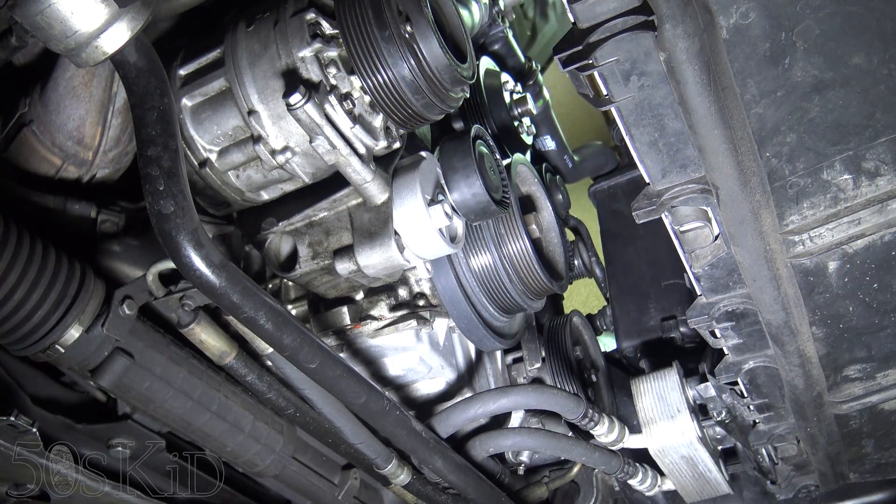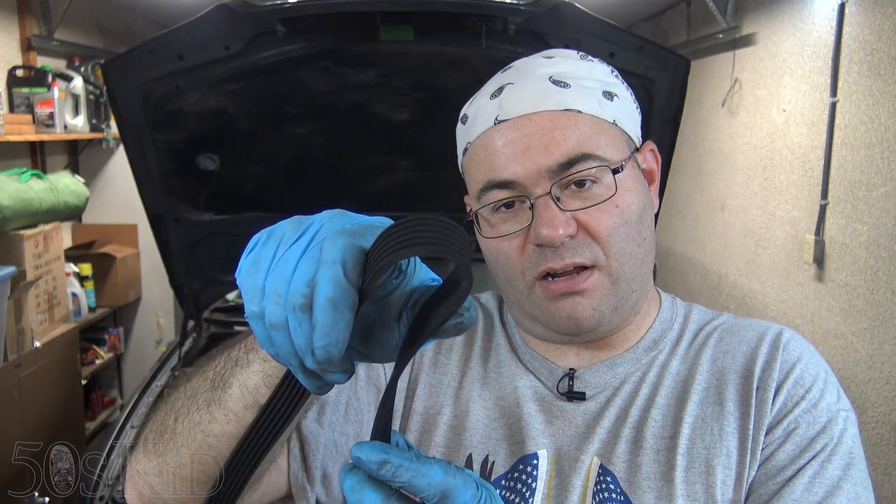And that is it. Now we just put the belts back on and put everything back together. This is a great time to check your belts — bend them back like this, make sure they're not all cracked, make sure there's no glazing on this side, make sure there are no missing teeth. If there are, replace your belts — they're about 20 bucks on eBay for Continental brand. I do recommend getting the INA brand pulleys to make sure you get good pulleys that aren't going to make noise when brand new. When you buy aftermarket, your mileage may vary.